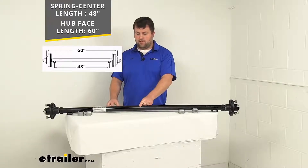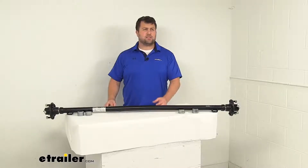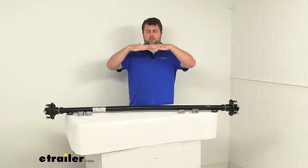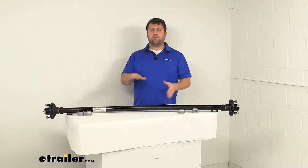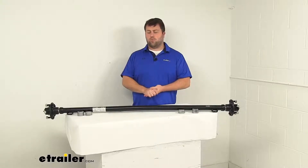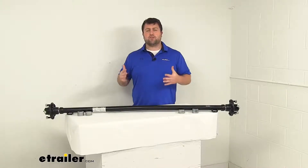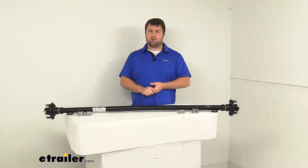This does have a little bit of a bend right here in the middle — you can see that's going to be our camber. That's going to ensure that even when our trailer is under load, our wheels are going to have a nice even road-to-tread contact across the whole width of the wheel, so you're not going to have uneven tire wear. It's going to be great for your straight line pulling and acceleration, so everything is going to be aligned properly.